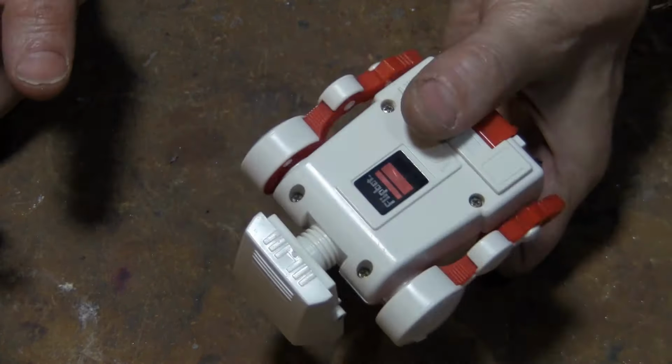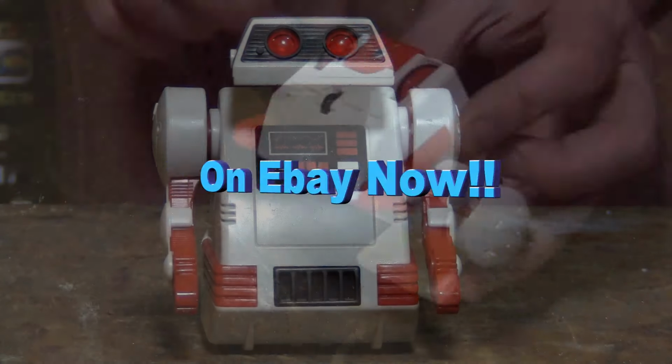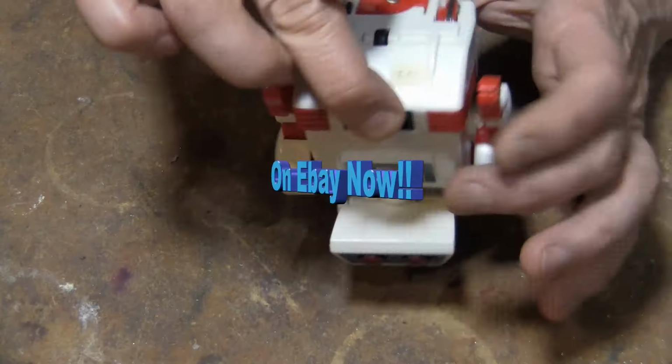So there it is, the Tomy FlipBot, and there was more wrong with it than I thought. There were actually two gears that were cracked. Anyway, it's all working. It's not that complicated of a machine, really. Basically, you have gears reducing the motor down. It also runs it through a worm drive to increase the torque and slow it down. And basically, it ends up just turning the wheels and turning the arms.